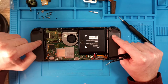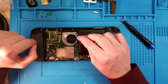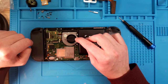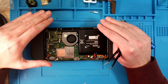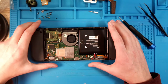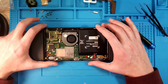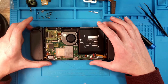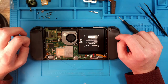As I mentioned at the beginning of the video, the charging of the Joy-Cons is using basically the same voltage rail as the fan itself. And of course, if the fan is shorting out, then it will pull down that rail, and the voltage will drop down so charging is not going to work. That's all for this video guys — I hope it was helpful and you enjoyed it. If yes, please don't forget to like, share, and subscribe. I hope to see you next time. Bye.